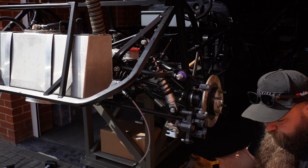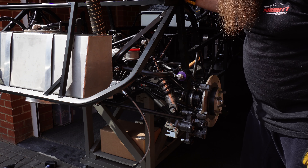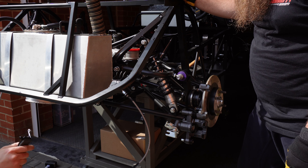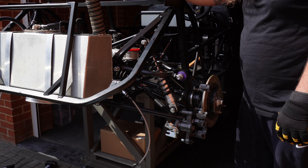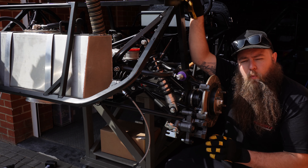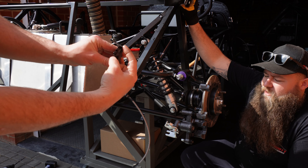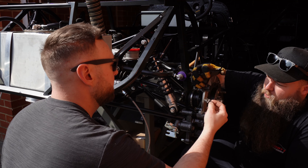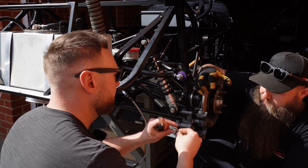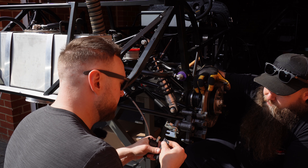We'll have a look at this side that I prepared earlier. The wear indicator squealer needs to go on the inside facing out, because when the pad wears down it touches that bit and squeals - you get that horrible noise. Before you put them on you need a little bit of pad goo on the dog ears. A bit of goo because you don't want squealy brakes. I've already squeezed it out onto the wrong side.